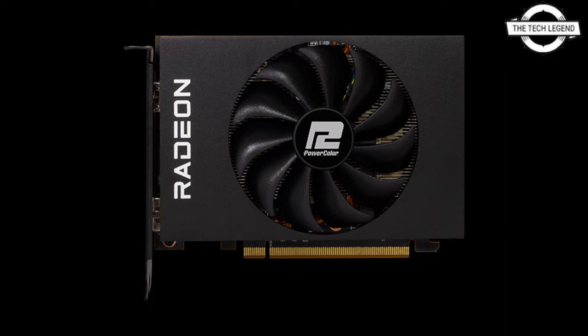The clocks are still listed by PowerColor, and it seems unlikely this model is overclocked at the manufacturer level. The Radeon RX 6500 XT is a 1024 stream processor GPU based on the Navi 24 design, and the graphics card is equipped with 4GB of 18 Gbps GDDR6 memory.